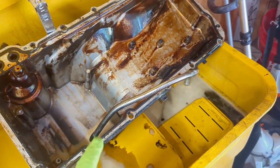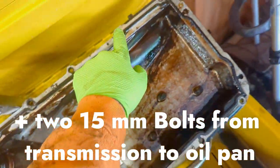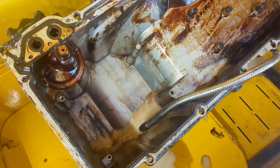You're also going to need a 24 millimeter socket or wrench to drop down your rack and pinion and get it out of the way, because its lines interfere with the oil pan. It actually took me a lot longer to get the oil pan off than it should have. The oil pan has two really long bolts at the back and a bunch around the sides and front — they're all 10 millimeter. Under the car you can see four 24 millimeter bolts that you remove to let the rack and pinion drop just enough to get the oil pan out.